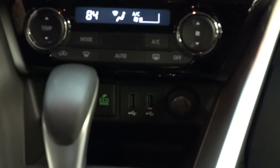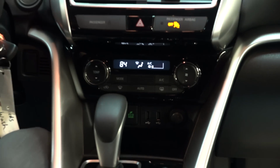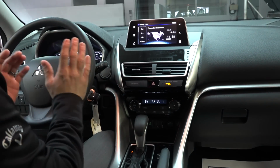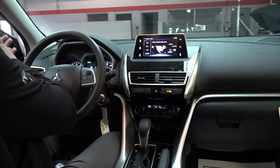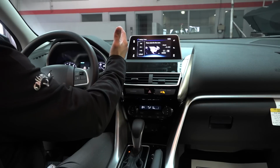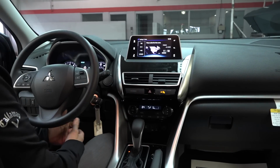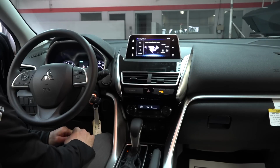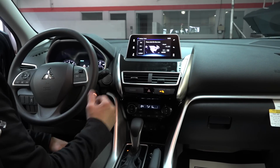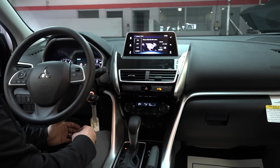So what that's going to do is it is a different braking system that's going to factor in yaw and pitch movement, and it's going to be your curve control. So going through curves, the inside of the curve is applied braking and then power is added to the outside. But it also is literally one of the most aggressive. We've literally had customers call into the store and go blown away at what the Mitsubishi can do in the snow and in different inclement weather. Especially here in Michigan, you get a chance to see it all.